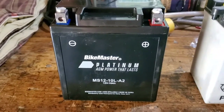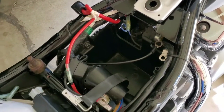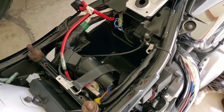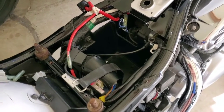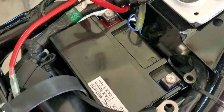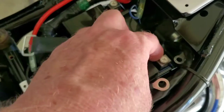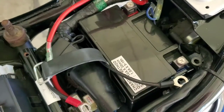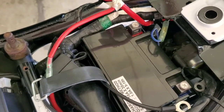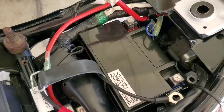You can see the plastic box where the battery goes — it's a little bit of a tight fit. I'm going to go ahead and drop it in with the video paused and then show you once it's in. I got the battery dropped in. One thing I did before putting it in, because it's kind of hard to do after: the terminals have screws that go into a threaded block underneath, so it's good to put those blocks in and loosely seat the screw beforehand.